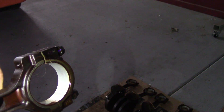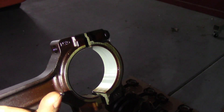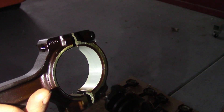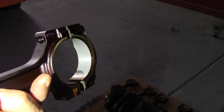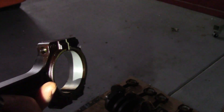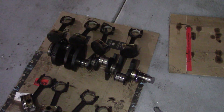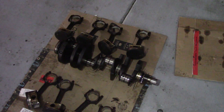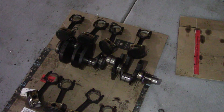You can see the bearings look basically brand new. So I'm going to lightly scuff them with some gray Scotch-Brite, the finest grit they have, or maybe I'll just put some 1500 or 3000 sandpaper in there. The main bearings on the crank are also good, so I'm going to reuse those. The mains need a very light polishing, something in the 3000 grit range, or maybe just an emery cloth.